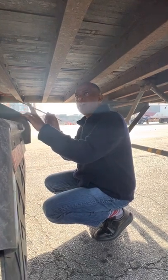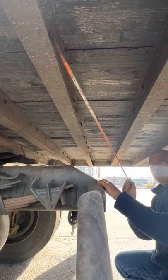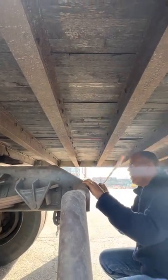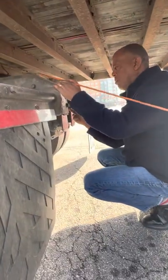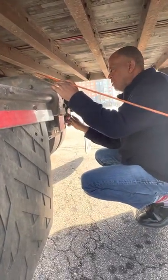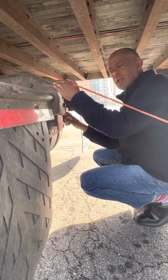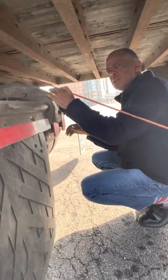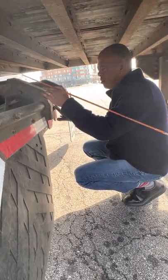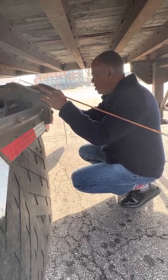These are cross members on the trailer — no damage, no illegally welded, no missing bolts and nuts on it. Now we have lights on the back. There is a brake light, a signal light, and also brake lights, and there is a reverse light. Check all the screws — make sure the screws have no missing or loose. And all the glasses — make sure it's not cracked or broken, should be properly colored, then it has to be in working condition.